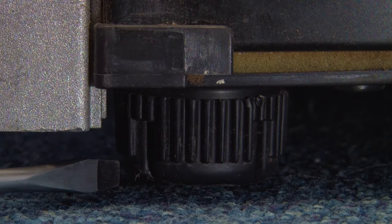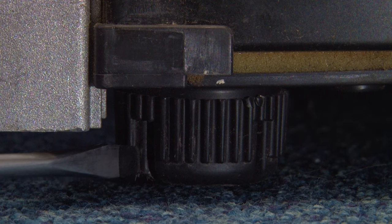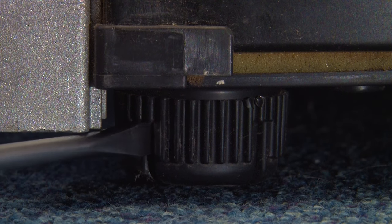Now for a few finishing touches. Now that the doors are back in place it's important to make sure that your fridge is level. If it's not level then it won't be possible to get the doors perfectly even. To do this just insert a flat blade screwdriver into the notch on the foot and turn it until you're happy.